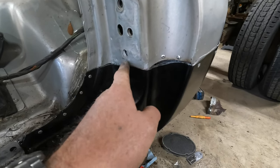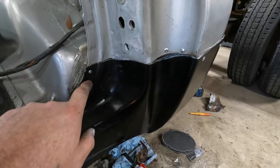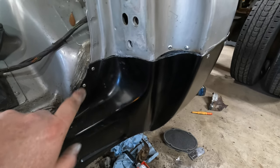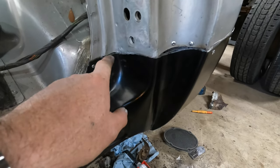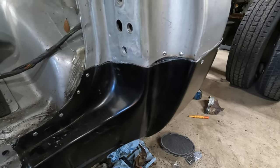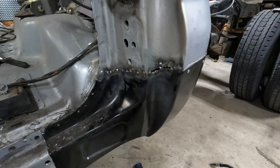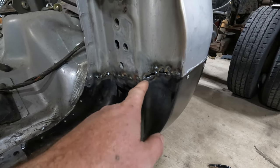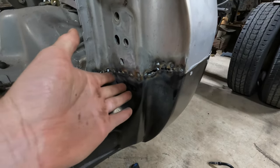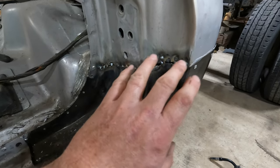Then we would take our butt joint and weld it back up. We need to be very careful when welding the butt joint because you don't really want to get the glue hot. There is a lot of seam holding this on, and you also want to be careful because this warps really easily. You need to be in and out with your MIG very quickly, then let it cool down before you move on. Right now I'm just stitching it in — putting a little dot about every half an inch or so, keeping them all spaced apart so we don't get it too hot and warp.